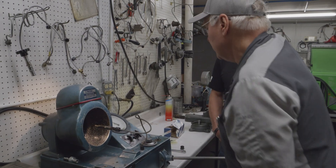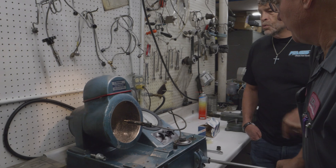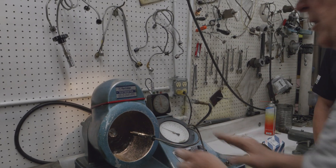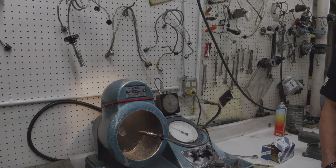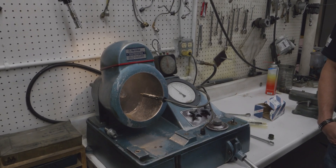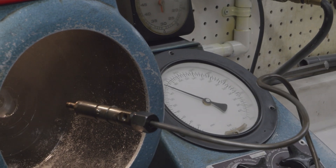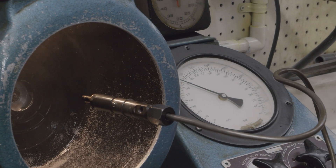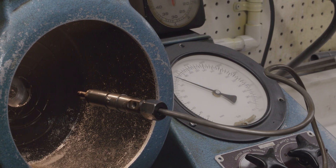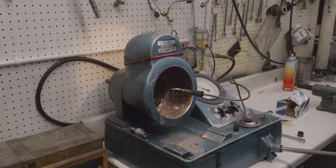This is somewhat similar — it's low on pressure. For the first part of the demonstration, this is an injector that's reached the end of its service life. It's not atomizing correctly and it would smoke, put out soot, and plug up the DPF and run a little rough. If you had a DPF and the EGR system, you're already polluting it — it's already starting to flood.